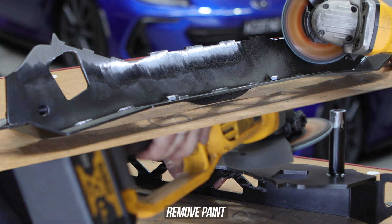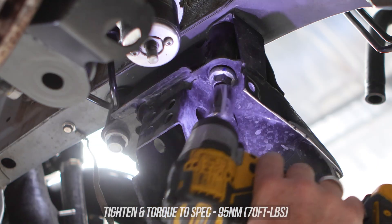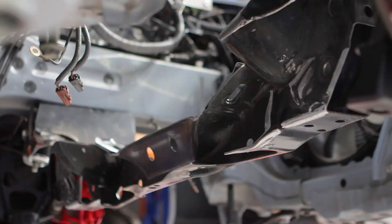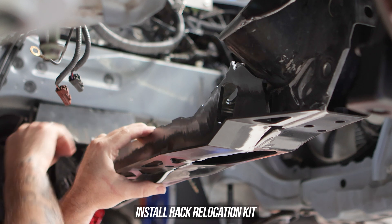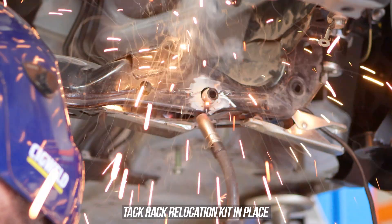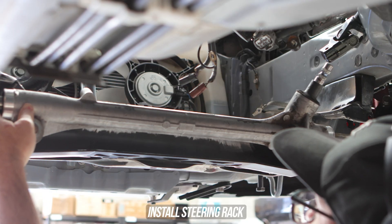Before laying those dimes, you need to set up the subframe in a jig — as we've said in the past, the best jig you'd have would be your own chassis. So go ahead and throw that up into place, then tighten and torque the subframe bolts down to the specs shown right here on the screen. Throw the rack relocation piece in and slide all the tubes through the holes, making sure for the last time that it all checks out. Now it's time to get your welding friend over — start by tacking the tubes in their place, then tacking the rack relocation piece on all four corners to keep it in place, as things like to move when heated.